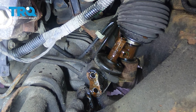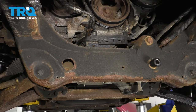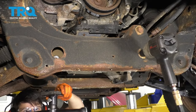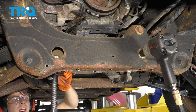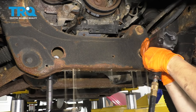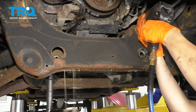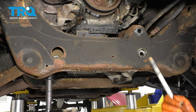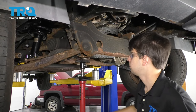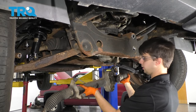Make sure you don't damage the boot, but just move that out of the way. The only thing left holding this rack in is two 18 millimeter bolts and two 24 millimeter bolts. I'm going to support the rack on one side with a pole jack so that when I take the other side bolts out, it has nowhere to fall. Once both bolts are out, let the pole jack down — the rack is not going to come out, it's just going to drop down a little bit. Then maneuver it out through the control arms. There's your old rack.